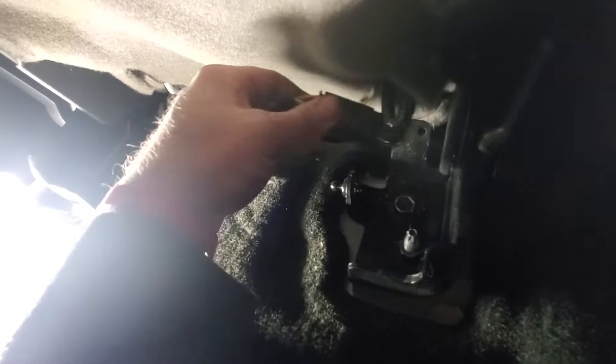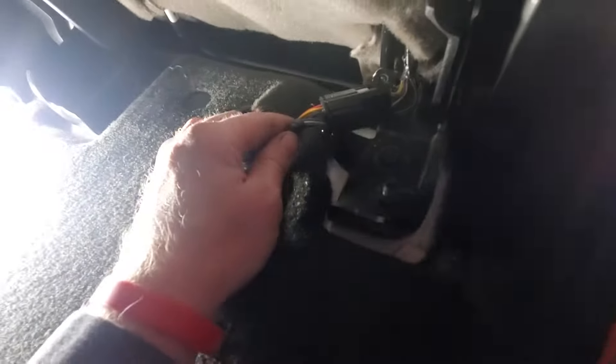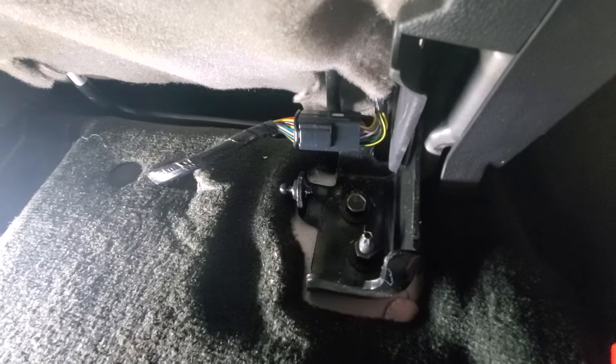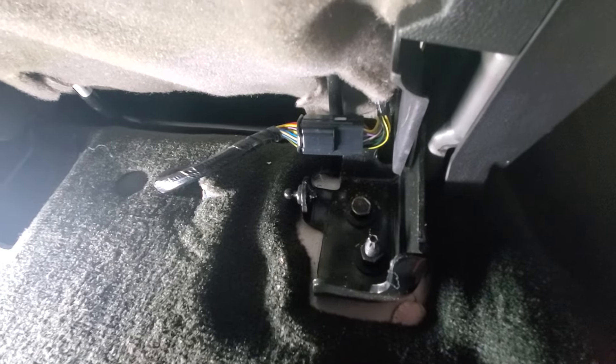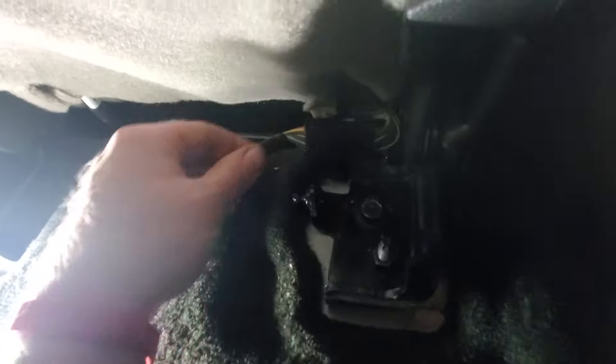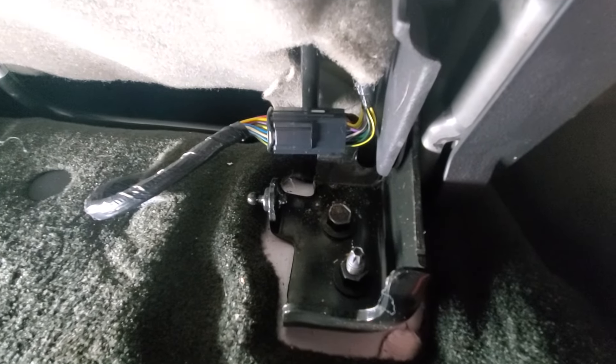Take it out, leave it out - it's fine either way. You're not going to hurt anything by leaving this out, it doesn't move around that much. These are for the people that want to fix these old ones that aren't under warranty and don't have a ton of money to spend. This is how I would do it if it wasn't under warranty. If it's under warranty, I'm gonna do what the TSB says. I find that relocating that wire and taking the stress off how it's being pulled is the real fix - right now it's really loose, there's no stress on it. That's my fix for this, guys. Thank you. Be blessed.